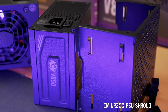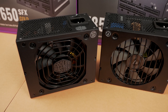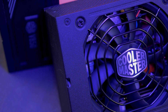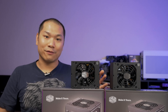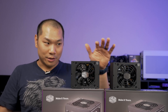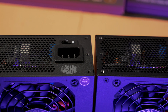These power supplies come in a relatively attractive appearance, with a thick durable layer of textured paint along with a cosmetic indentation on the side showing Cooler Master's logo and model identification. The front grill is quite nice looking with a CM logo emblazoned in the center. Underneath that is a fluid dynamic 92mm fan which won't spin up until about 15% of total rated capacity — meaning the SF 600 and the EVGA GM 650 will spin up a lot later than the 650 watt unit here, though the fan wasn't really noticeable from a noise perspective at those lower levels.